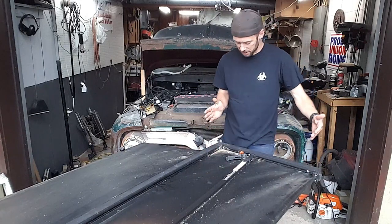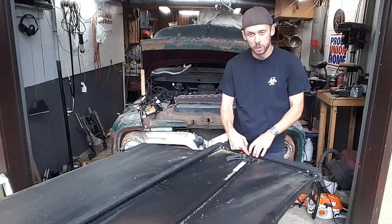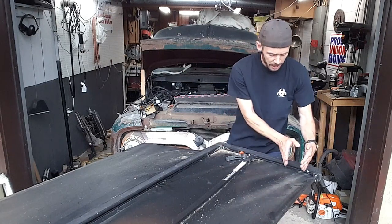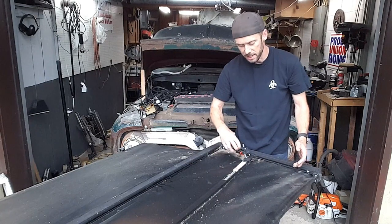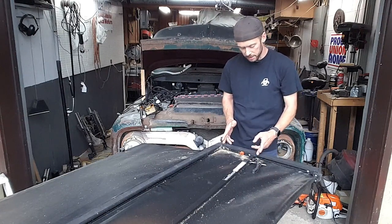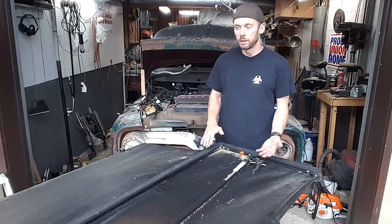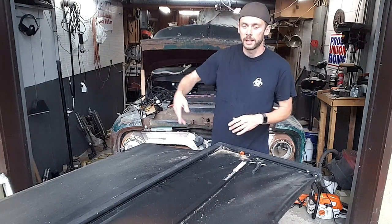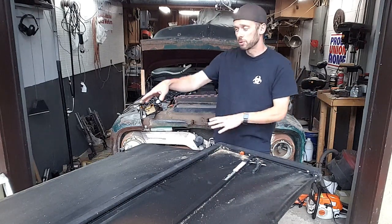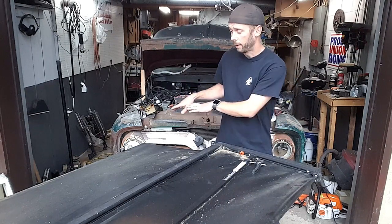To take 11 and a half inches out of this section, we're going to take this bar and slide it down. This is in a track system, so it should just be this one screw — loosen it up, tap it down, move it to the same distance from the edge that it is now. Then we're going to cut this section out and move this bar down, then slide the whole vinyl top to the back. Once we've slid the whole top to the back, we can wrap it around, cut the excess off, and probably screw it into the frame on the back. Since it's up against the cab, it won't be that noticeable.